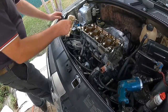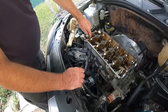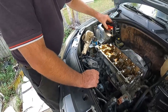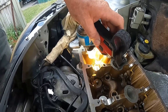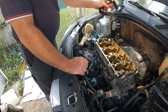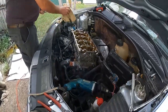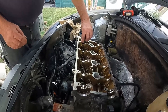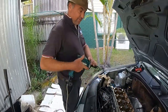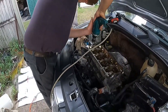I will try the extractor once I get it to shift, but it's in a tight spot. Fortunately, because I stopped before it sheared off on this one, I've got more of the original Torx shoulder to reach in and hit. There's not a lot, but a little bit. When you're doing this type of job, this is the one thing you don't want to happen. I've told boys at work, told other people — never heard of this happening before. I'm sure someone else in Renault land has seen it, but let's keep going.